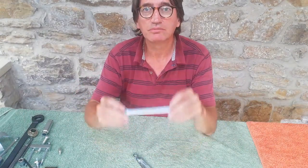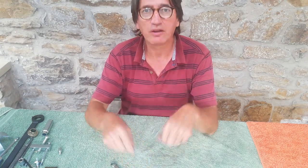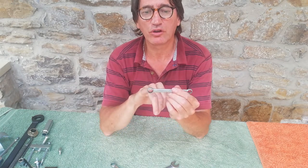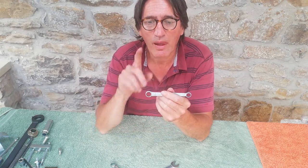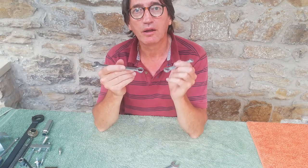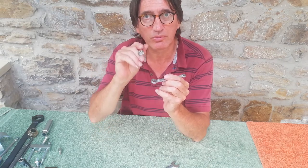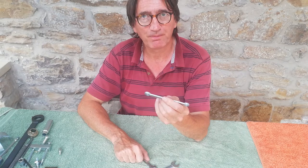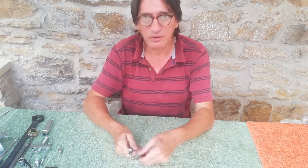You'll also need some Whitworth spanners. And here's a Triumph tool — a star spanner, sometimes called a Tricor spanner. It's not a normal spanner; it has little serrated teeth which go on the serrated nuts on the bottom of cylinders on Triumphs, but they also fit standard nuts. The big advantage of these spanners is they're much thinner than a normal spanner, so they'll go in over the top of the nuts on the base of the cylinder on a Norton where you can't get a normal spanner in because the nut is too near the bottom fin. Just thin enough to drop down and give you a proper ring spanner to loosen and tighten cylinder base nuts.